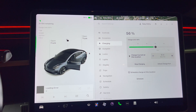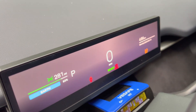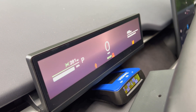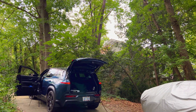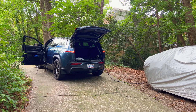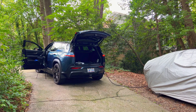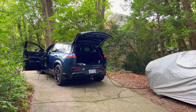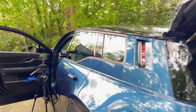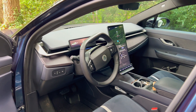I do have an EVSE with that connector and I need to find it. As long as the car is in ready mode, it appears the trunk outlet can stay on. The car has been charging via the EVSE for about 17 minutes and we're at 12 amps, which is pretty good — matching the amp load on the V2L adapter. However, we have to have the car in the ready state with the key fob in the center console.